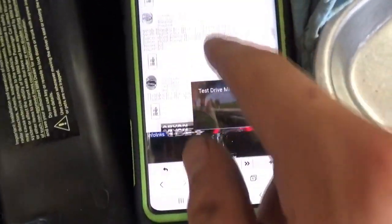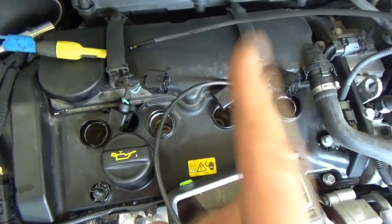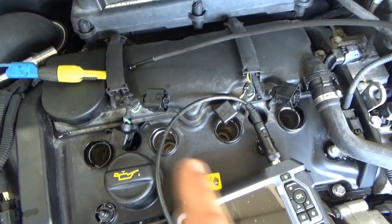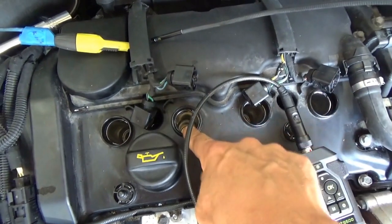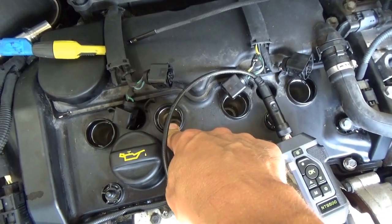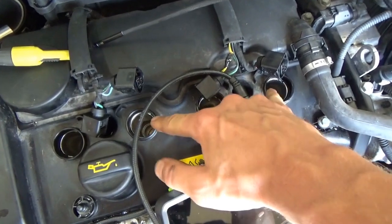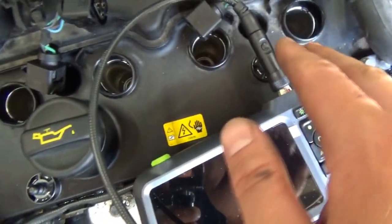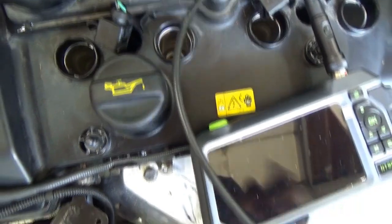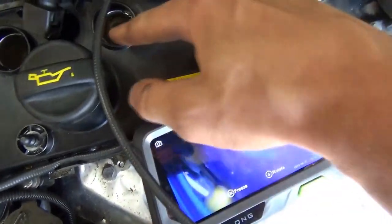All Data is indeed wrong — this is not a magic engine. The actual firing order is 1-3-4-2. Classic. So on the relative compression test, cylinder one is good, three is good, and then four and two had low compression. They're not side by side, so it's not a blown head gasket. We still need to do a leak-down check to determine why those two cylinders have low compression. We could do an in-cylinder pressure transducer or use a borescope as a visual inspection to look into cylinders two and four.